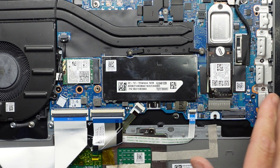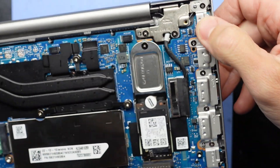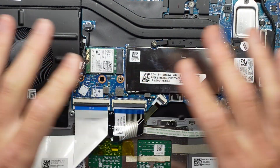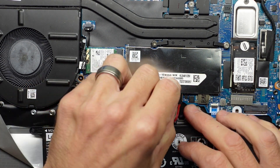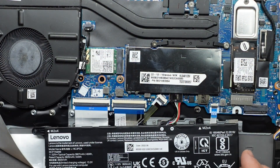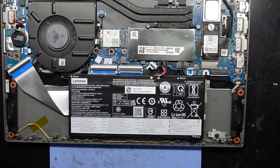There is also a CMOS battery over here. Charging is handled by the power delivery — it'll go into one port. I'm going to put this battery back in, loosely sit it, line it up, push it forward, and that should click into position. Then line the battery back up, put the screws back in, and we can proceed with putting it back together.